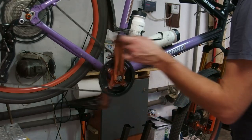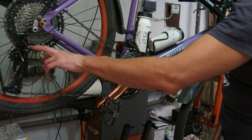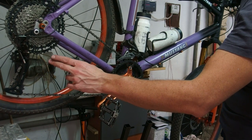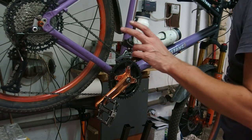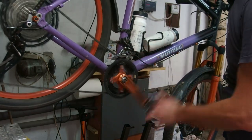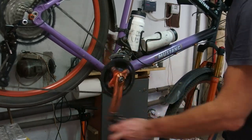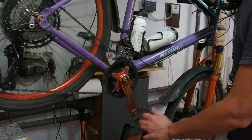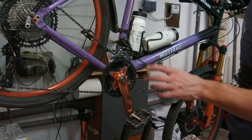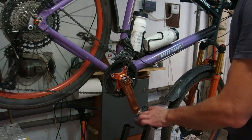and this shift, as you can see, is very violent, and that's because the guide pulley should be a little lower, but I can't get it any lower because that would make the shifting on the big ring quite a bit lazier, possibly even impossible. As you can see, the lowest gear is actually forcing the derailleur on the lowest gear. Now, this is acceptable, after all, this is Chinese equipment, but if this was some sort of wonder from Shimano, I would probably be, well, kind of annoyed with it.